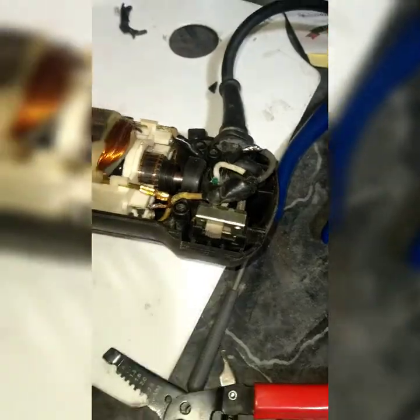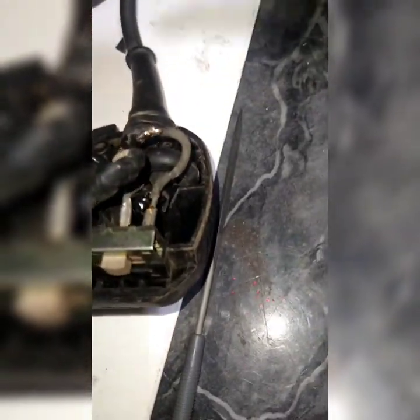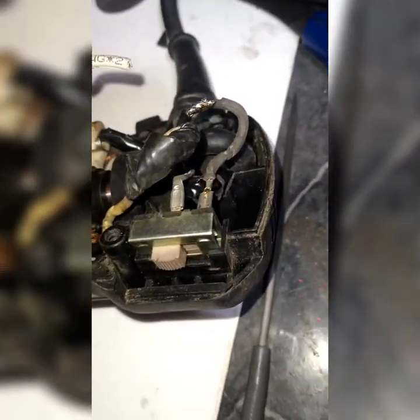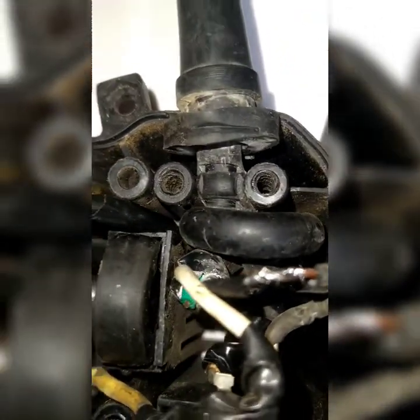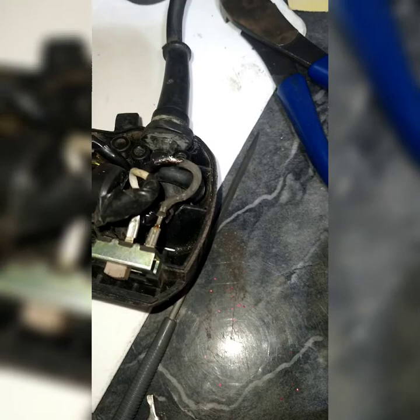So this is my Rotozip repair. The white wire — you can see here — it goes right through that crack there, because I actually opened it a bit more. It looked like a U, then I broke a bigger chip off and got a bigger gap so it can go right in between. Basically, the wire goes under that big wrapping of wire, jumps over here, and it's soldered over here too. I just did the black wire too — cut the excess off. Still looks a bit rough, but I'll test it. It's my tool; if it was somebody else's I'd probably do the whole wire from scratch and solder it directly on, but it'll work.